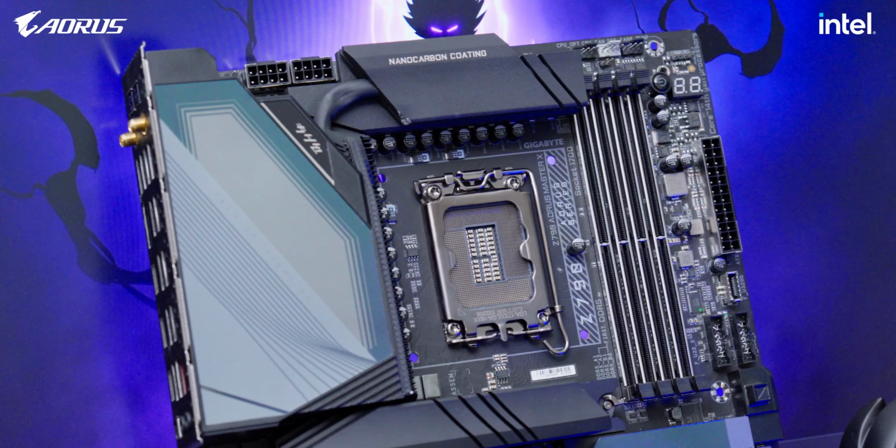And I'm telling you, right, Gigabyte has not compromised in this section. They went with a digital direct VRM design. That means you're getting a 20 plus 1 plus 2 phases design, and out of that almost 20 phases are directly going to the CPU only. These 20 phases also have a parallel power design. That means you're getting a 10 plus 10 design, and each phase is having around 105 amps. So multiply 20 by 105. So totally around 2100 amps are dedicated solely for the CPU to bring out the best potential and max performance out of the CPU that you'll be using on this board.